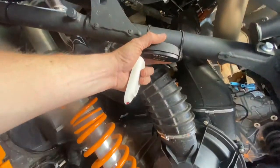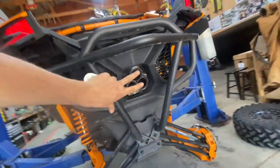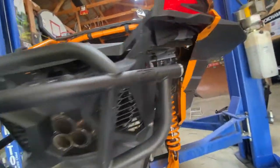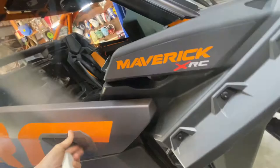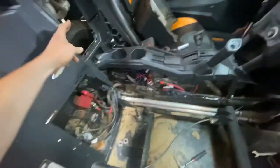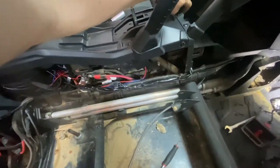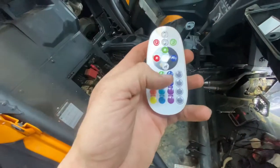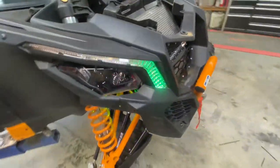On the back end of the machine we mounted our rock lights on each side, and we actually put an LED strip right above the muffler so when everything's on it glows everywhere the light pushes through. Run those wires up, down, across, and over into the console - very simple. Once you have your wires coming into the console from the back and from the front, tie in your controller box - I wired it into a switch - and then you can use the controller to roll through different colors or use the app. It just takes a while for running wires and keeping them clean, but there are our rock lights rolling through colors, all our plugs, and there are our accent lights rolling through colors.